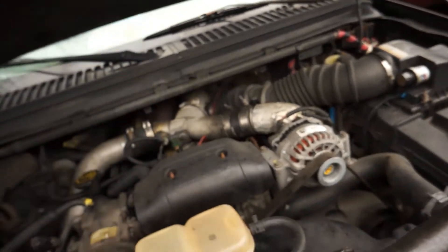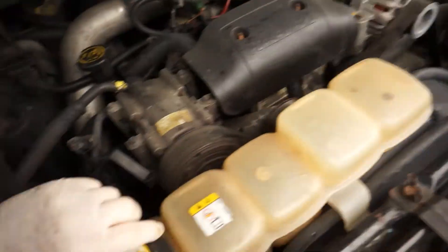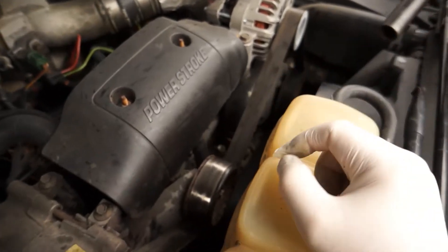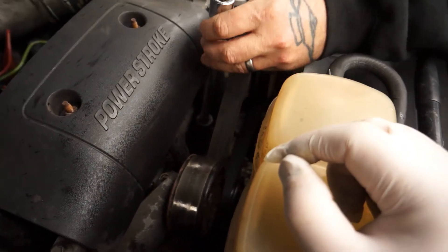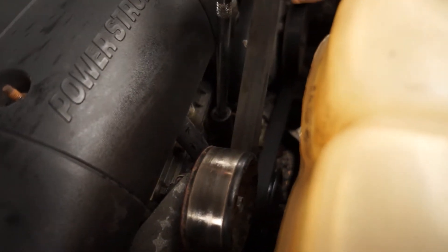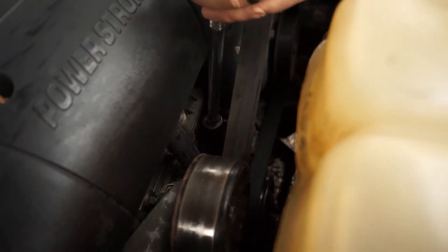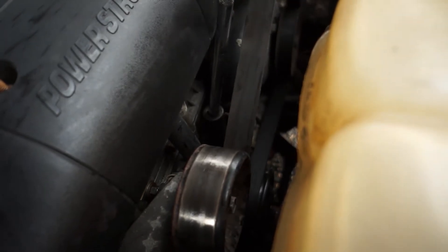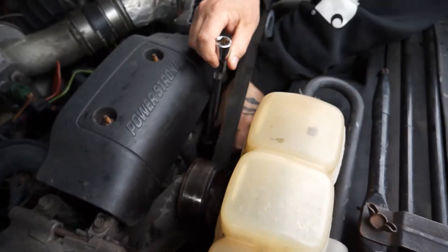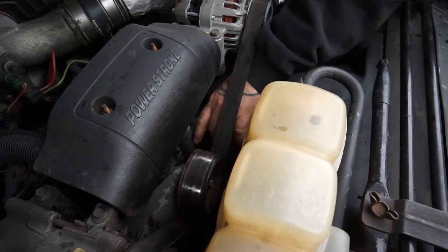Make sure if yours is under pressure you can relieve the pressure by doing the radiator cap. Have a drip tray underneath there, and basically he's just going to unloosen that slowly so the antifreeze drips down onto the drip tray. If you open it too fast it'll burst up in your face and get your eye, so he's just going to open it real slow and let it leach out the bottom. He's got that 19-millimeter deep well socket and he's just going to undo it by hand.